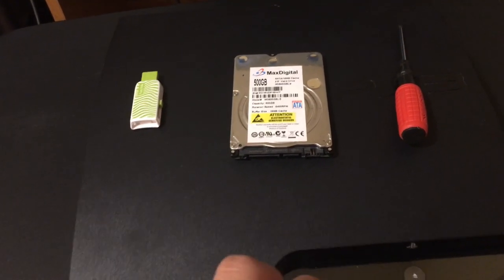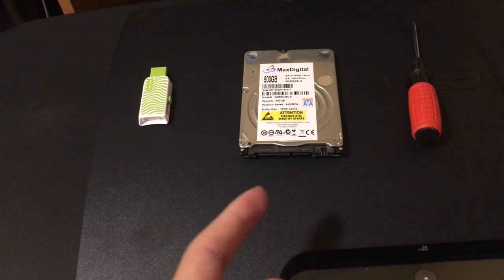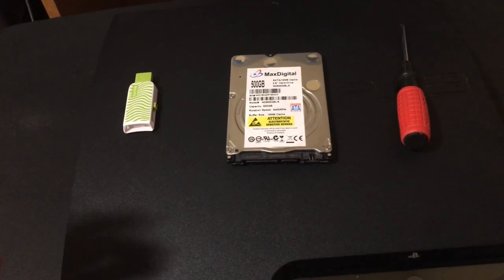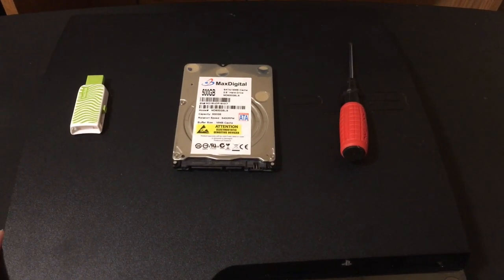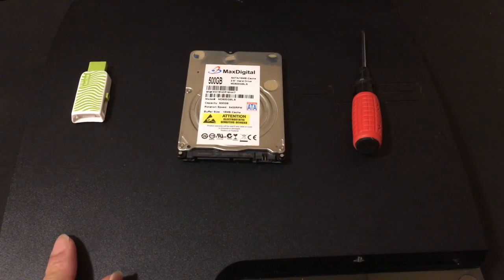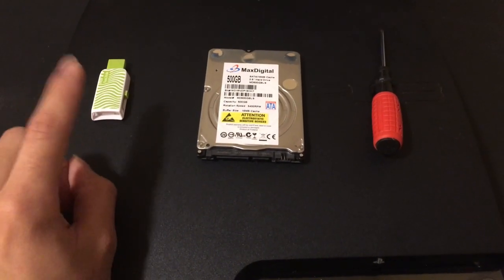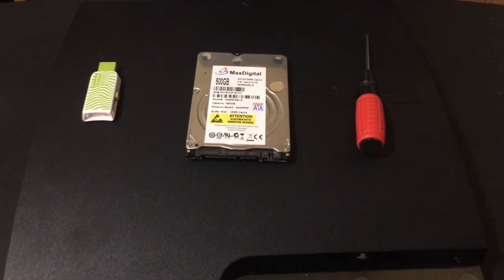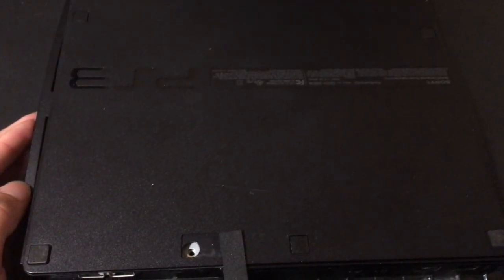For today I'm going to be using my regular slim. I'll have a link below for this hard drive — I got it for about $22 via eBay and went with the 500 gigabyte one. With the USB as well, we need to go ahead and back up your data — this is optional for me since I don't have anything on this PS3, but make sure you back up any save data or files on your PlayStation 3 before doing this process. Any time you put a new hard drive in, you need to reinstall or upgrade the system firmware and reformat the hard drive.